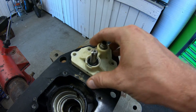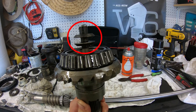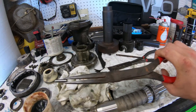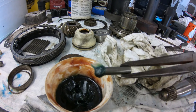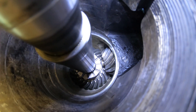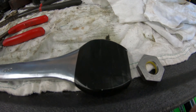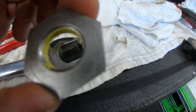Grease up the o-ring and slide the housing down into place. Now we can take the prop shaft assembly and install it the same way we removed it — pushing the shaft to the right and hooking the lobes onto the shift crank. You can then look down through the drive shaft hole to make sure the clutch dog is shifting back and forth properly. Take some needle bearing grease or good marine grease and install all of the needle bearings back into the lower unit. Once all bearings are in place, slide the pinion gear in and insert the drive shaft until the pinion gear is onto its splines. Sometimes it's easier to get the nut started by using electrical tape on the wrench to hold the nut in place.